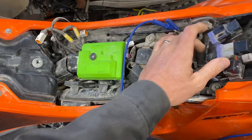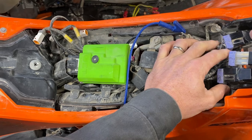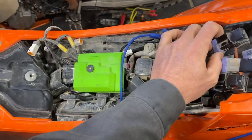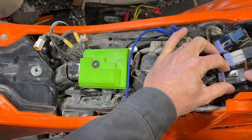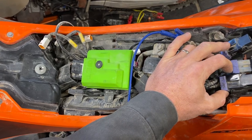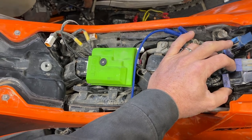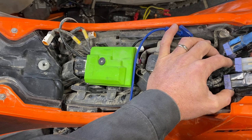Here's one other pro tip. Let's say, for example, your fuel pump relay was bad — you activated it and it does not work. What you can do is swap relays from another circuit. Your fan might be important; maybe it's daytime and your lighting is unimportant. So you could just swap out these two and get the rest of your trip done on the lighting relay over here in the fan position. And when you get home, you can replace that relay.